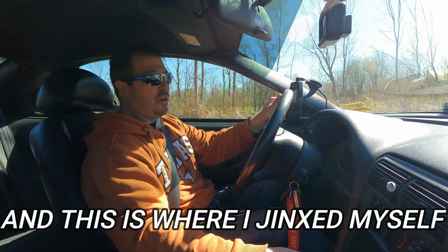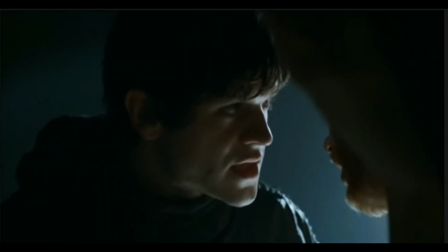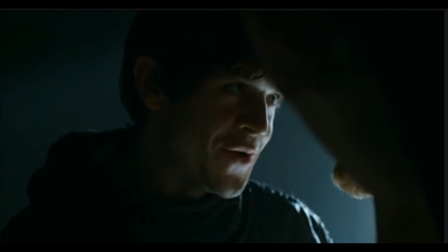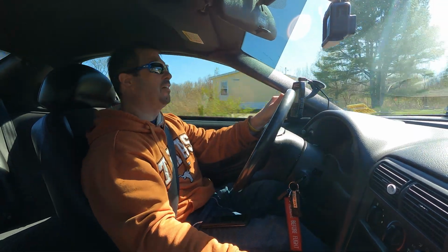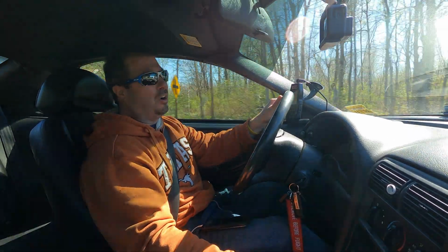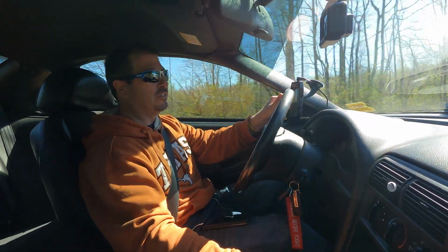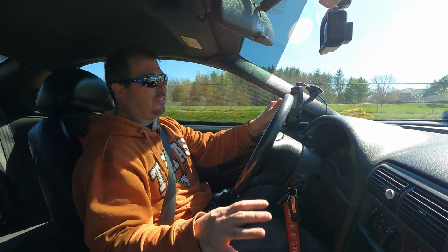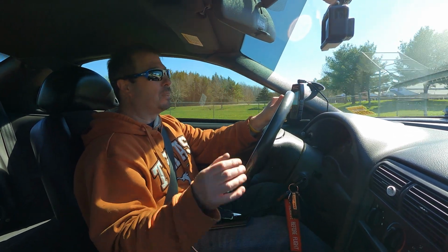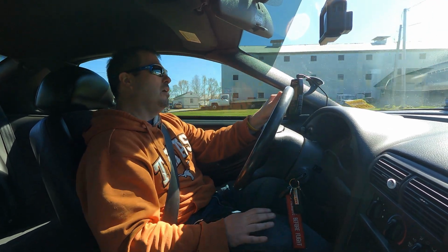So basically I'm driving the car with no belt right now. If you think this has a happy ending, you haven't been paying attention. I'm completely not serious. Of course there's a belt on the car, but what we did was we had to remove the snub idler on my billet flow 4-piece pulley set. So the snub idler is off, so the 75.5 inch belt fit, and it's tight. It's tight even with the snub idler off.